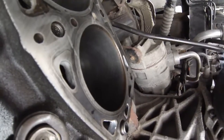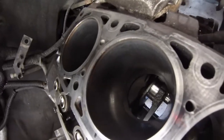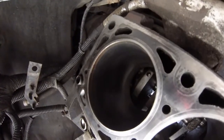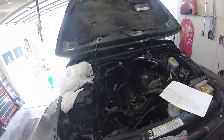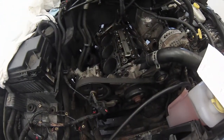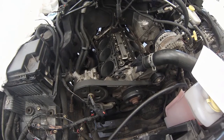If you look around this side, that's the one that has not been done yet. This engine is still new enough where you can see most of the hash marks and they're pretty prevalent. So in reality we're more just doing an overall deglazing. We're not putting a lot of pressure in there, not doing very many passes — just looking to get rid of that glaze so the new piston rings will seat properly.